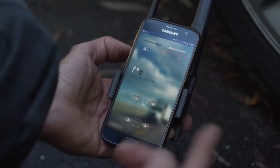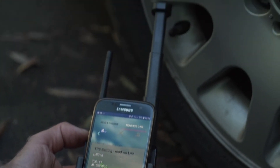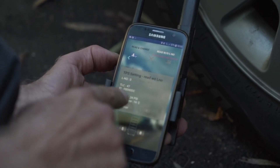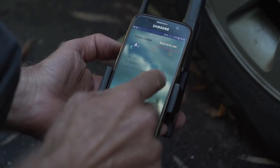At the right front wheel, we go to Read Without Location Number and hit Go. We're going to read this tire sensor now. You can see the sensor is set to location zero — it has the ID, the pressures, and everything. We clearly identify the tire sensor.